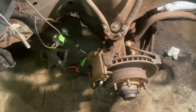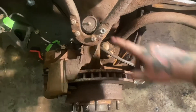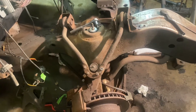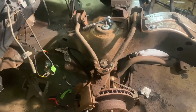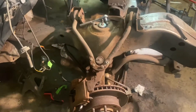I'm also going to be lowering it — I have a two inch drop spindle and a three inch drop spring. As you can see the frame is all crusty and dusty. I do plan on using this truck a lot, so we're going to strip everything down from the control arms and then get going on grinding the frame down and painting it. Let me start taking stuff apart and we'll update you in a minute.